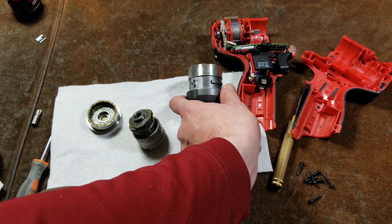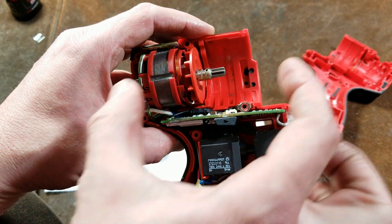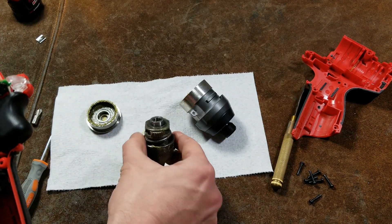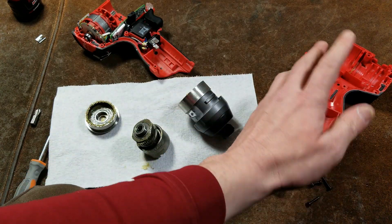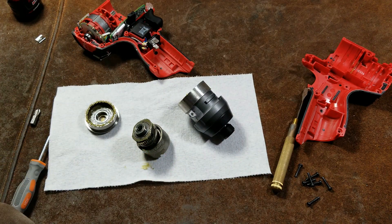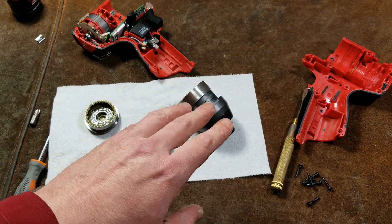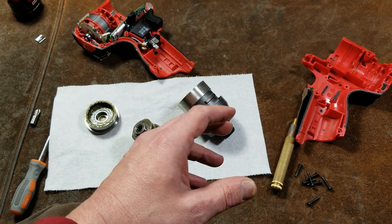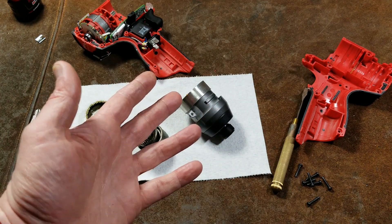That's the teardown. What we've learned about what Milwaukee has done to shrink this tool down is that they've integrated the front ball bearing of the motor into the inside of the hammer assembly, saving roughly a quarter to five-sixteenths of an inch in length. The handles are 30% fiberglass-reinforced nylon, which is good — tools of yesteryear used fiberglass-reinforced polycarbonate. Nylon is a bit cheaper and more compliant; polycarbonate is extremely heavy duty but tends to break completely off, whereas nylon is more forgiving and will crack but hold together until you get new parts. Thanks for watching and subscribing — until next time, Cadis Maximus out.